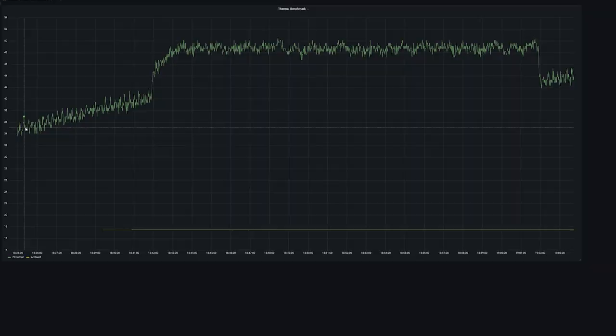So I was quite surprised that, for the most part, the fan never kicked in because it was set to 50 degrees. Now, at idle, I would have a temperature at around 42 degrees, and that's fine. But as soon as I stressed it, the temperature hiked to 49 degrees, and occasionally the fan would turn on for about 5 seconds, then turn off because the temperature wouldn't really rise above 50 degrees.